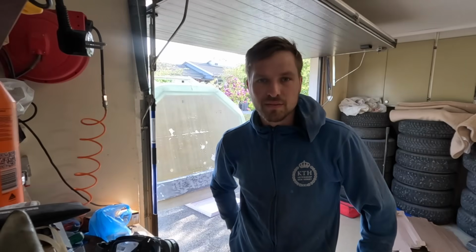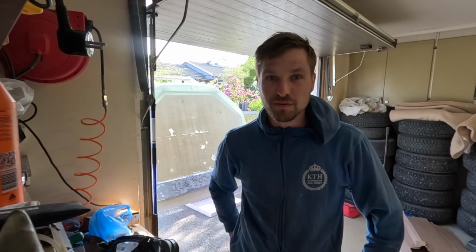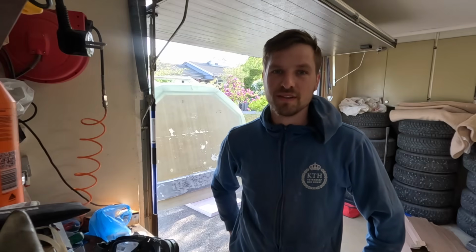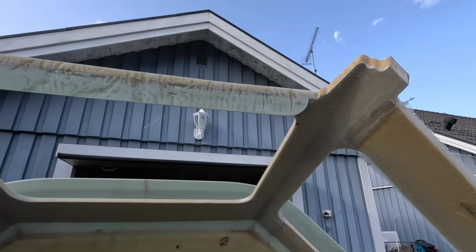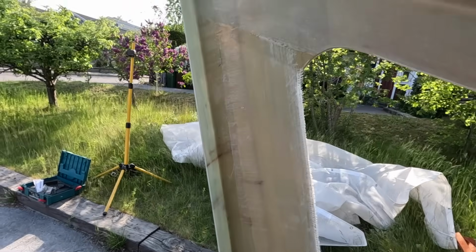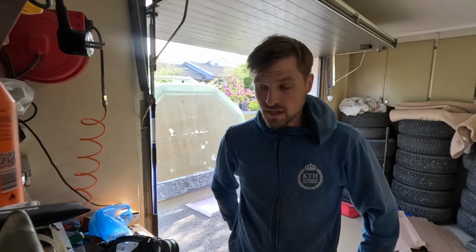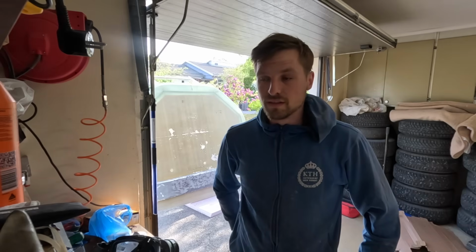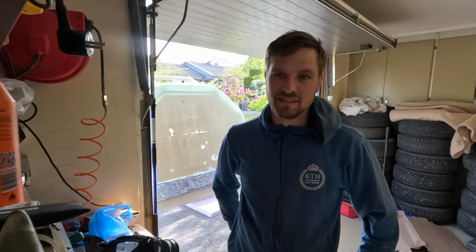So the other day I said it was time to start with the fairing of the doghouse. That was maybe a bit optimistic, because I spent quite some time pre-sanding, trimming stuff, and laminating a bit around the windows to get the wall thickness even for the mounting of the windows later. I also cut the mounting screws and a lot of different stuff. Those are the kind of things that you tend to forget also take time.